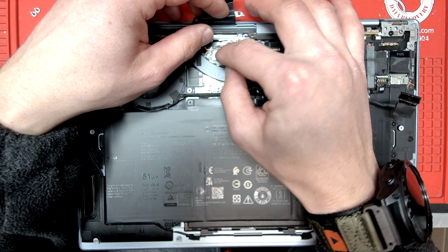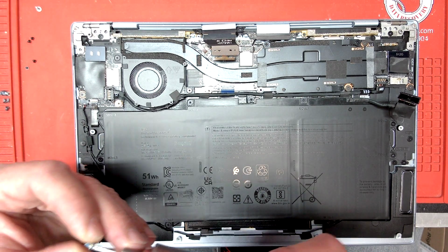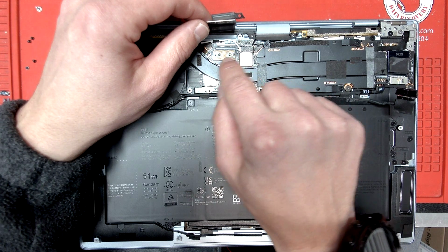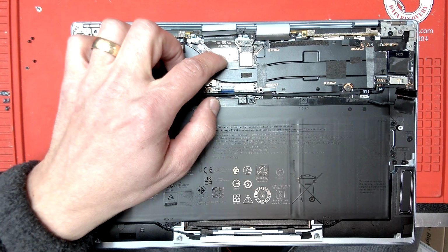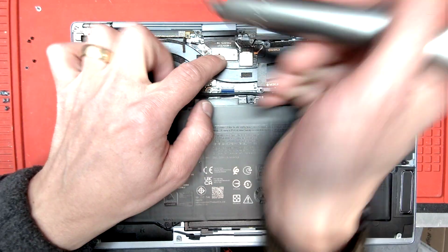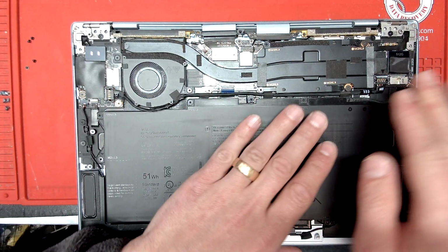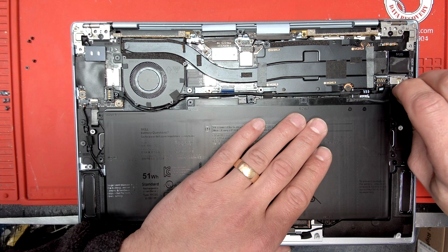Okay. So we put this guy down. And we'll put the LCD connector. Hold on. The LCD connector, you see there are two little rods protruding from that. You have to align it to that, hold it down there, put the screws, one and two. Okay, now we're ready to put the battery in, so we fire up the computer and make sure that the screen is working.